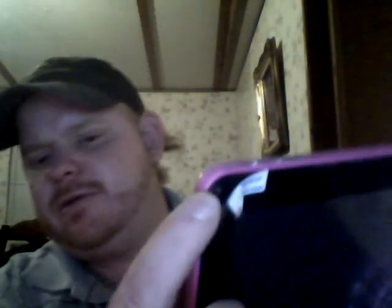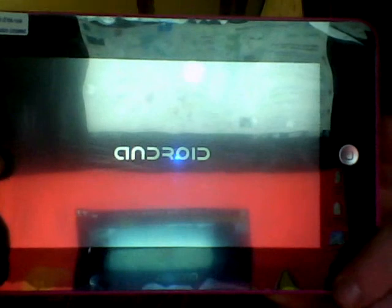That is how you disassemble and reassemble. Now you just slightly pull the corners back, see the screw there, take your precision screwdriver, and run your screws in. If you want, you can wait before you run your screws in and do a simple power test. Android with the underscore flashing — that's a good sign. As long as you see action on the screen, that is good. But if you have the Android underscore and it is not flashing, then something is wrong. Or if the Android logo is not flashing, then something is wrong.